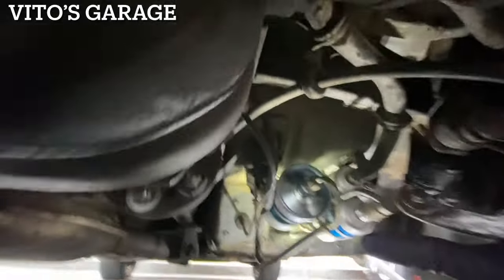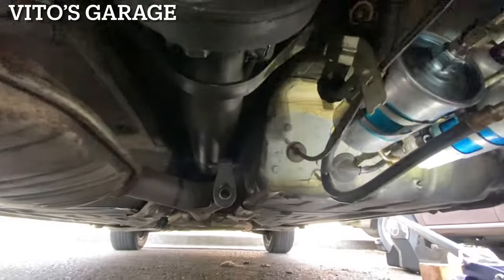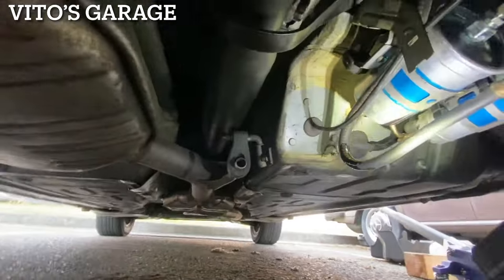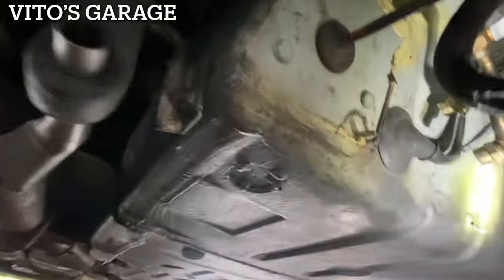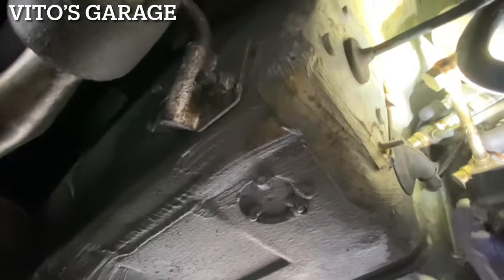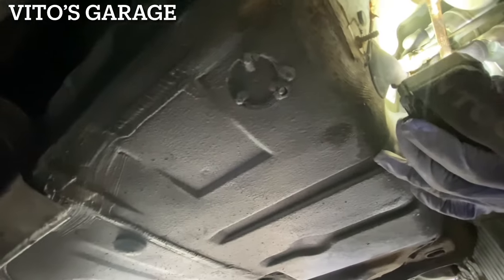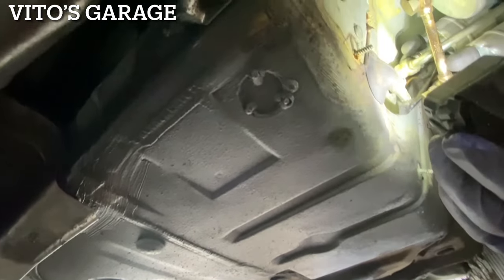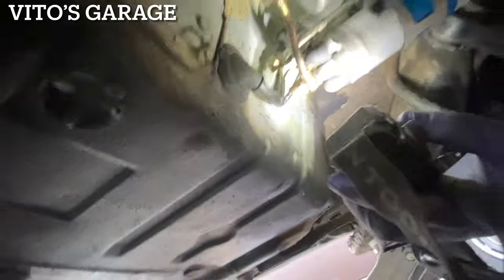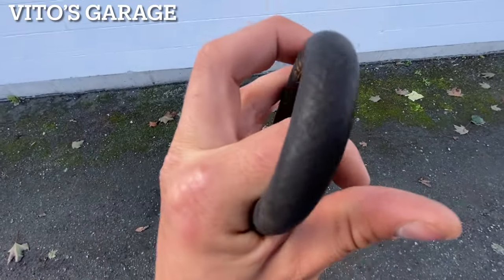The car is running. I've installed two new pumps and the fuel filter. This hose is going to get replaced — it's just temporary right now while I'm checking for other leaks. As you can see there are no other leaks, everything looks great up here and over there too. So far so good — it's only dripping from this hose right here. That's where the fuel started leaking.